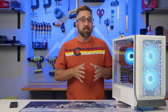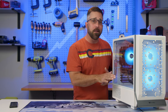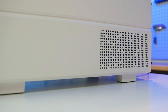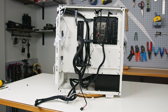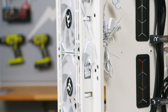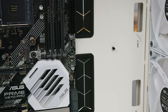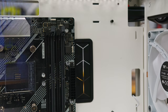For those planning to horizontally mount a thick 3.5 to 4-slot graphics card, or perhaps a second card in a lower PCIe slot, the fully perforated PSU shroud and filtered intakes on the bottom left and right of the case should provide excellent airflow — particularly if you add that bottom fan. Cable management was a dream, requiring just the provided straps and a few zip ties. I was particularly fond of the clips in the front of the case, which allowed me to neatly route fan cables behind the front panel and out of sight. I also appreciate the grommeted pass-throughs, which are becoming increasingly rare in the sub-$100 case.